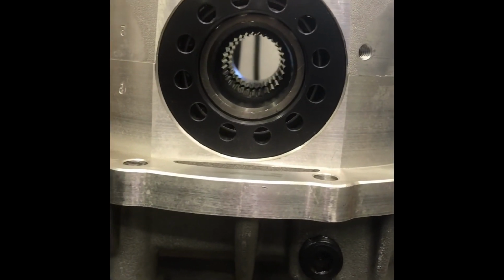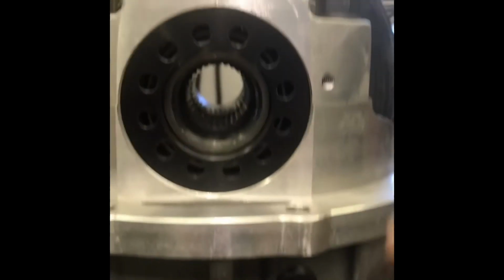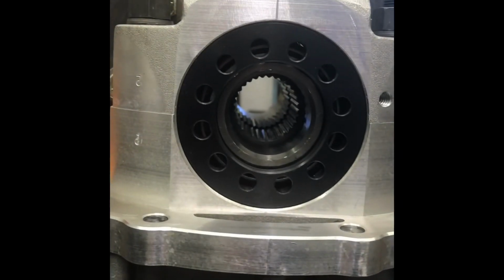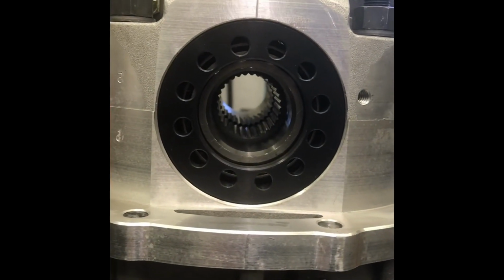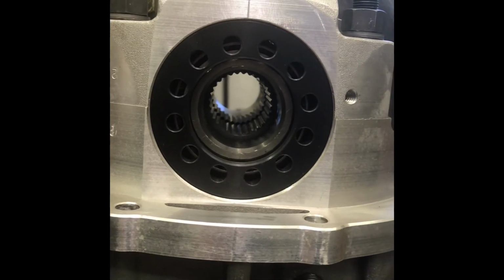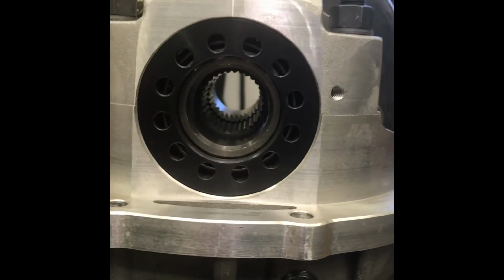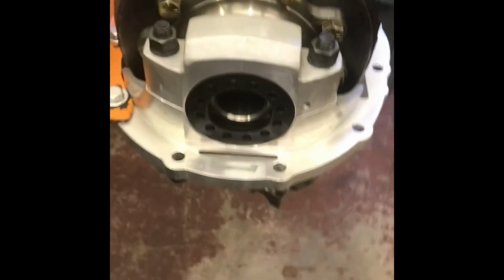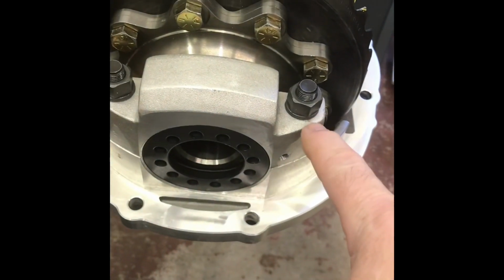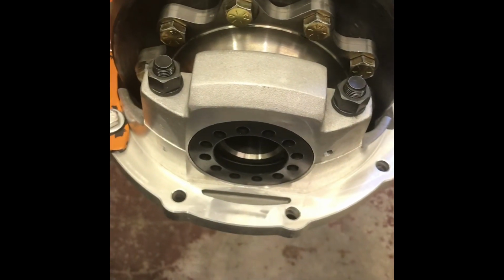This goes for an iron case too, I use the bolts as a guide. You know, hold the cap up, start the bolts, and set it down flush. If it doesn't go flush, it's wrong, I promise you. This was going together, it felt perfect, but it was off by a sixteenth of an inch at the bottom. It's wrong. So I fixed it, pushed it right down flush. And also with these wrist tight, that should spin easy. Another clue that those are wrong, if they don't.